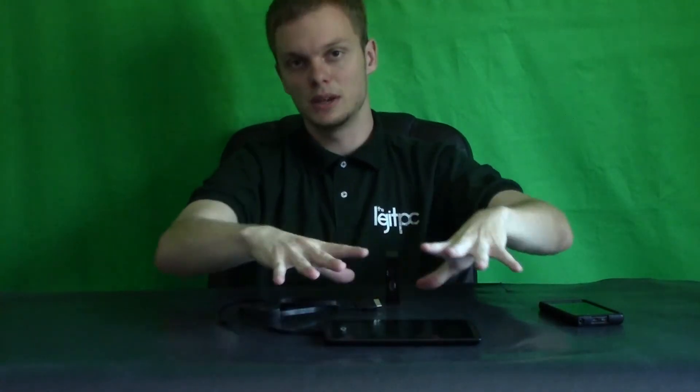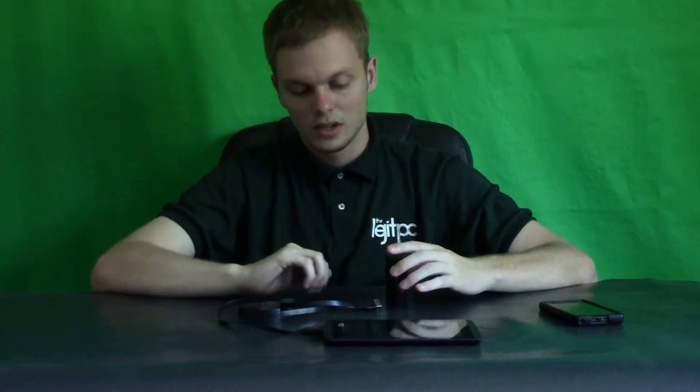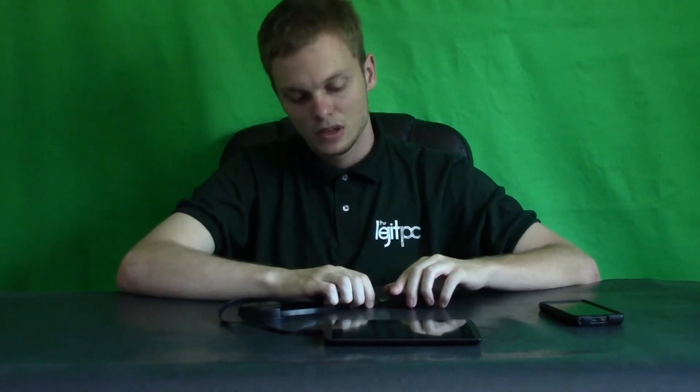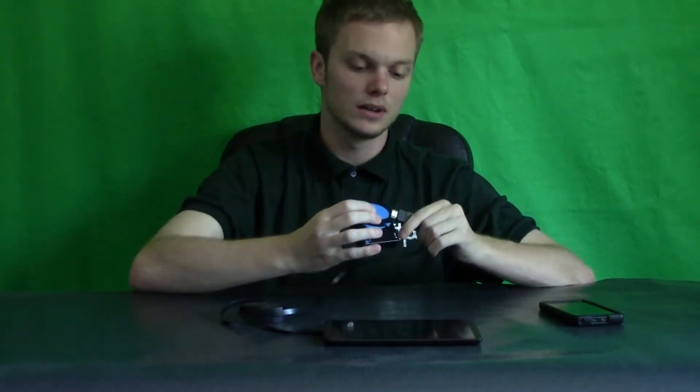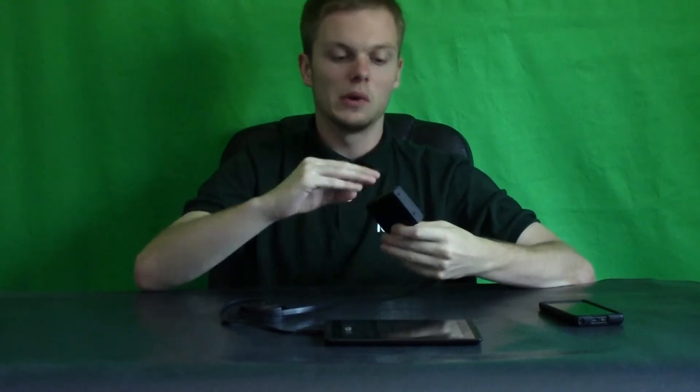Or you could get around this $20 device right here. There's another method with a tablet called rooting, or what iPhone and Apple users call jailbreaking — getting into the software to manipulate things. That would probably void warranties, but I'm not completely sure. I just wanted to spend $20 just in case I might want to return the tablet and get a better version. Basically what you could do is find instructions online to root your device, then get into the software and disable HDCP. So you don't need the splitter, and you would only need one HDMI cable — it goes straight from the tablet into the capture card.